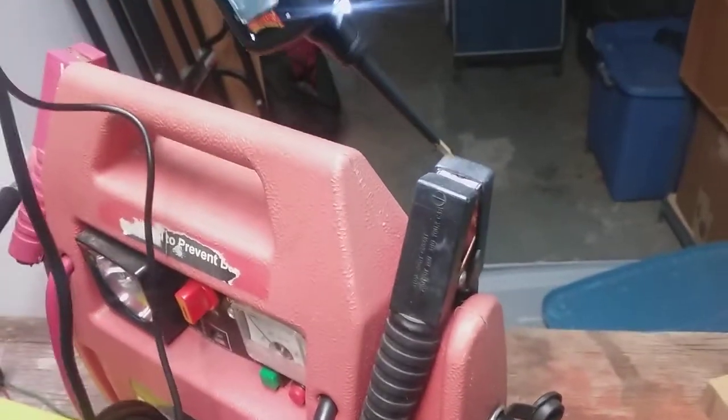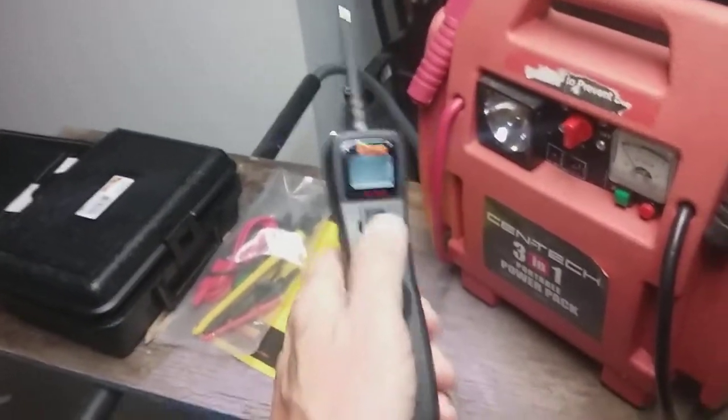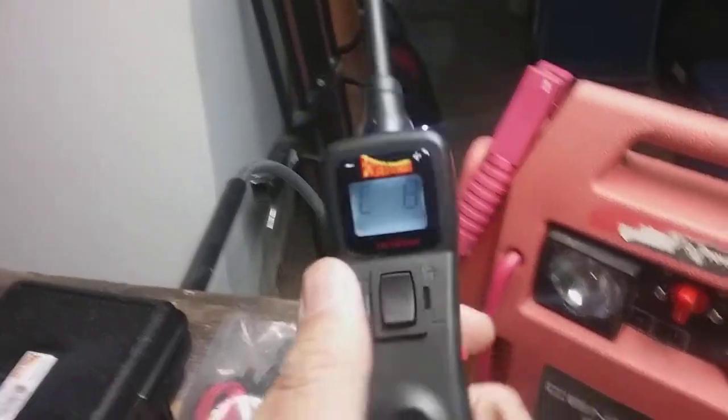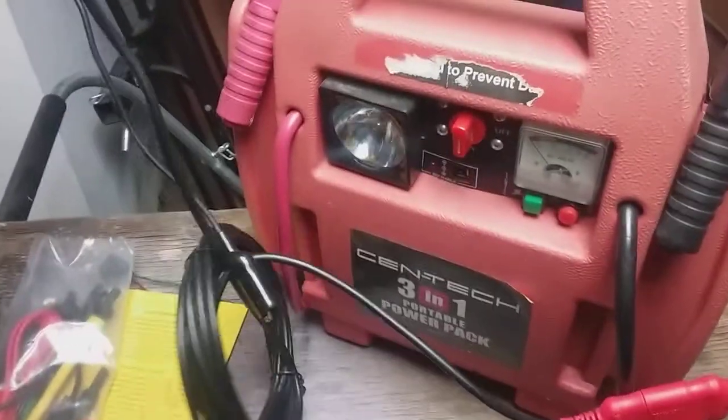So how do you prevent this? Well, here's how. First of all, on your battery in your car, if you're going to use this just to test sensors and not to send power and ground anywhere, you trip the breaker first. You touch ground and send 12 volts to ground — and there, you've just tripped the breaker. Now that you've tripped the breaker, this thing still works as a meter. It still shows voltage.